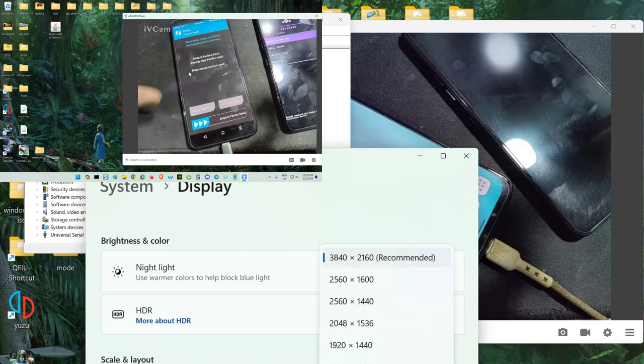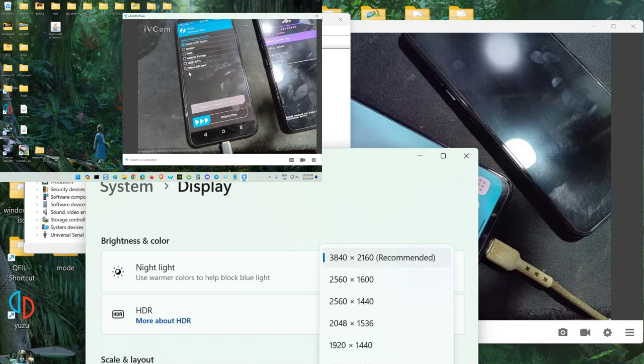Wipe. Now we are wiping the current slot, the active slot, slot A on the V50S. Advanced, Dalvik, system, data, don't wipe internal, only that. Swipe. See the error on this recovery, even the V50S recovery also has a problem like that. Wipe again, format data first. Yes. Lousy recovery.